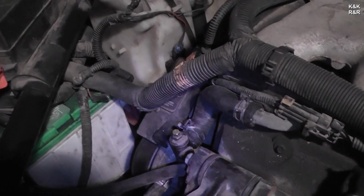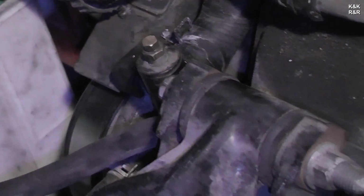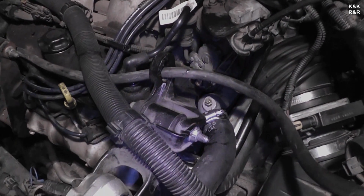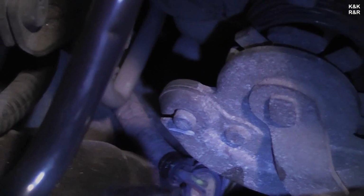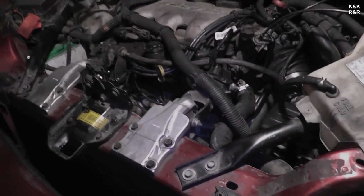So you'll notice GM has two air bleeders for that purpose. First one, you have your second one, where's that? Right there. So we're going to use those two as we're filling it. Other than that, this job is done. Some of the symptoms we had, obviously when she's going down the road, coolant temperature dropped. I have to say the smart guys that worked on this last decided to replace the coolant temp sensor instead of the thermostat to fix a gauge that wasn't working. So yeah, never a dull moment in the automotive industry.